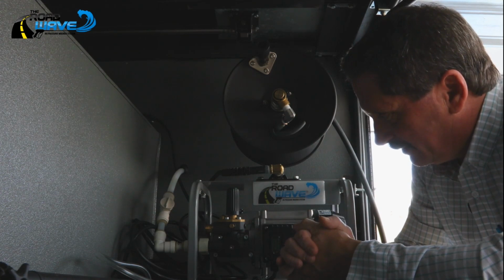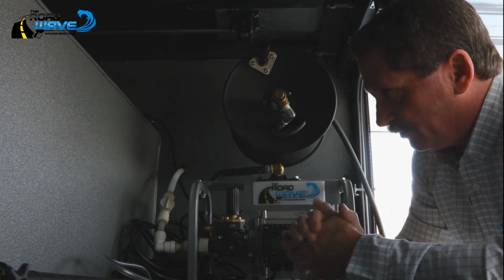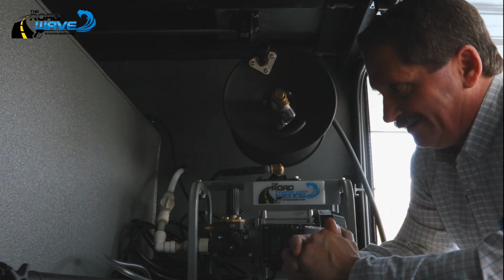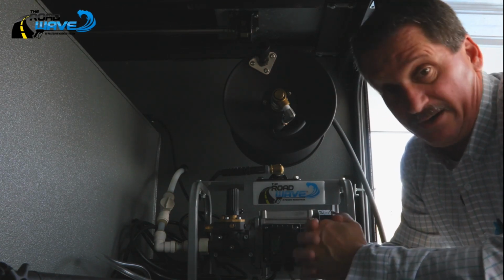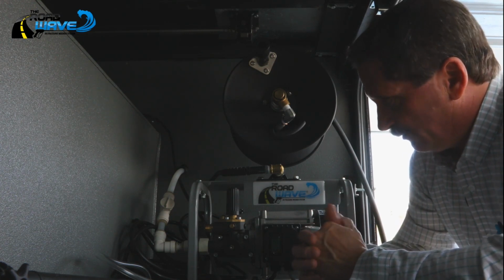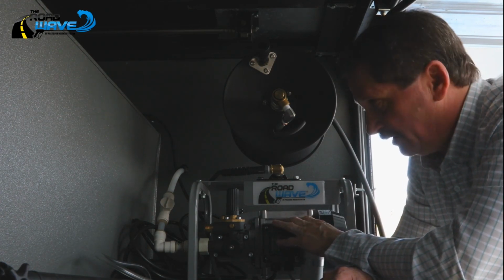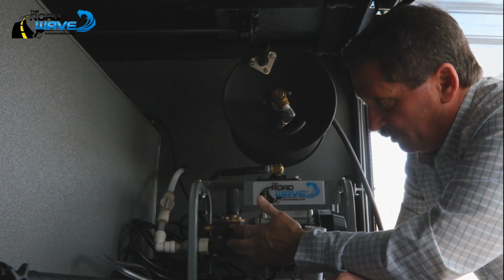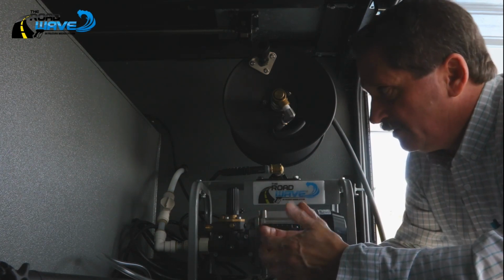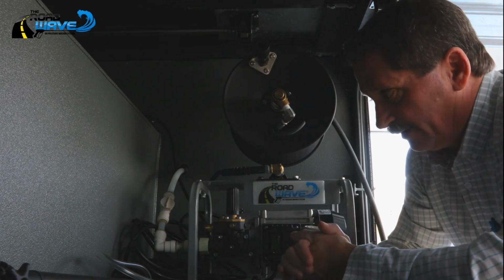We tested all of the pressure washers that you would be able to buy at a Home Depot or a place like that, and when you put it in a confined compartment like this and close the door like you would to wash something, they typically didn't last very long at all. A lot of them actually burned up or caught on fire. So we had to take it up a level, and what we have is an induction motor here, and this motor is designed to keep cool in all environments. And then we have a commercial pump, and this pump actually is an oil bath pump, and what that does is it allows it to run cooler too. We can actually plumb hot water, 108-degree water, into this system, and it works fine.